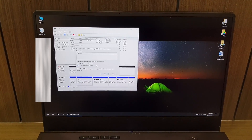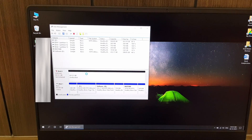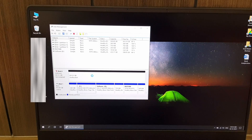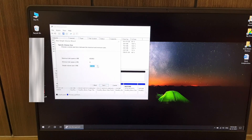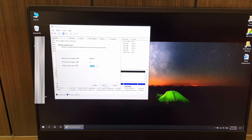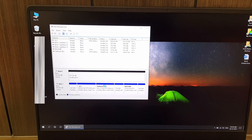Let's turn it on and see whether it works. Now you can see I opened the disk management tool and it is recognizing the drive as disk 0. I'll make it a simple partition. I'm not really sure whether to give it as a single drive or multiple drives — I'll just allocate it as one, automatically recognize it, and create a new simple volume with full volume size. Now I'm going to format it with NTFS file format.